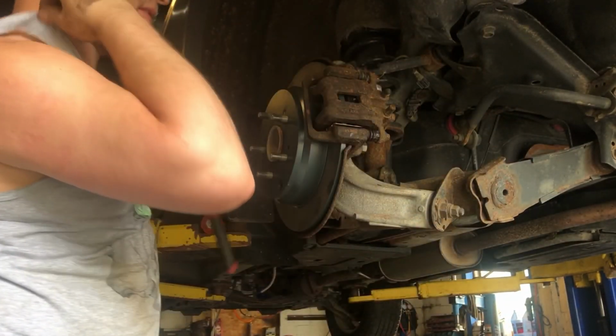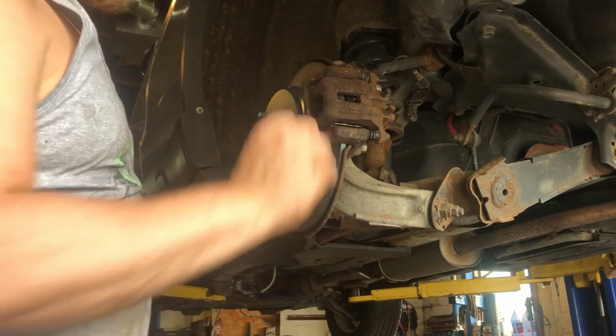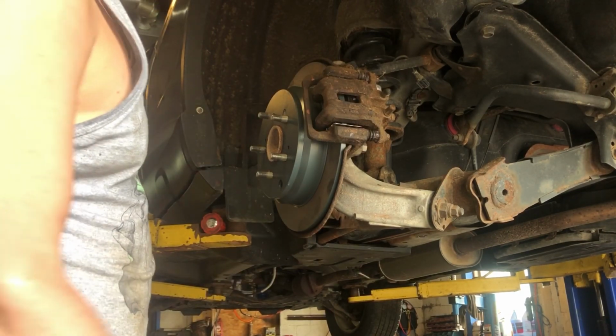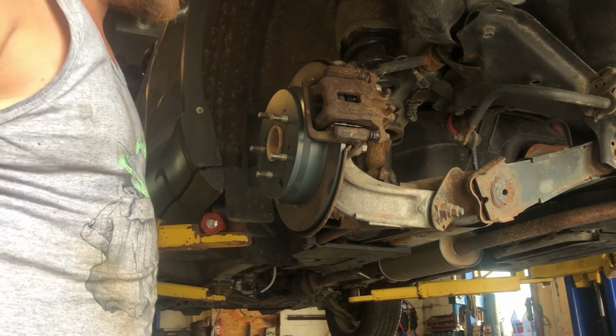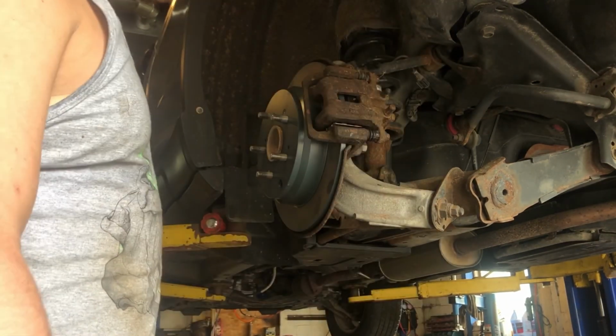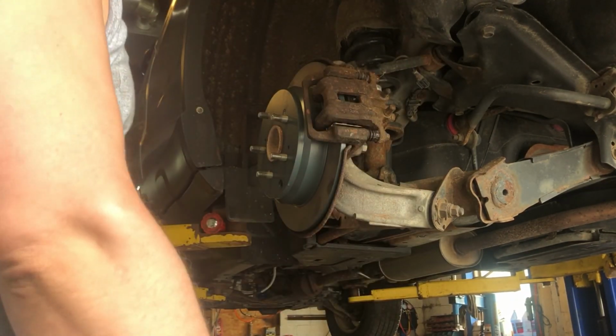They stayed still. All right, so we're going to want to prime our brake pedal. Get that caliper to press the pads into the rotor. And proceed with bleeding the brakes. Got to do the other side and then prime the brake pedal, bleed the brakes, and there we go. Put the tire back on, it's all done.